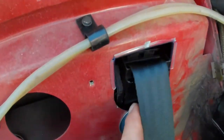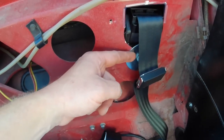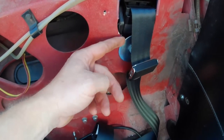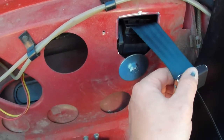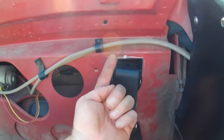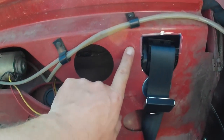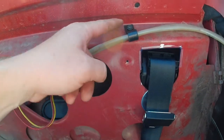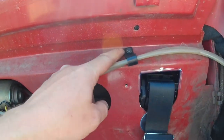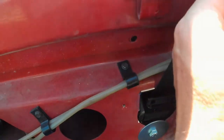There it is. I did put just a little thin washer on the inside of the red here just to give a little clearance for the top of this mechanism to come forward against the red metal. I've got it angled just slightly — I don't want it to run straight up because it'll run into the hanger here. I want it to be kind of off to the side next to that hanger, so I think that'll be plenty of clearance. I relocated that little holder — I just drilled a little hole up there, I think that was like a 5/32 or something drill — used the same hardware just so that the belt wouldn't rub on those hoses. Now I think we're in good shape. It does kind of rub on this vinyl here but it's minor, and as far as chafing goes, it is not going to chafe.